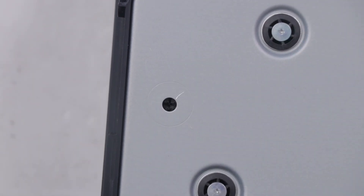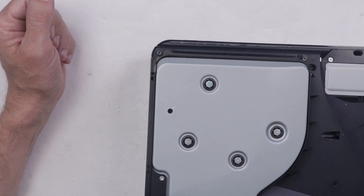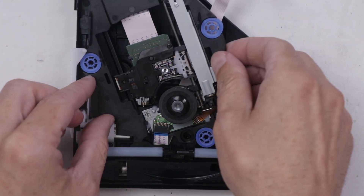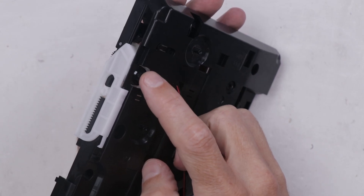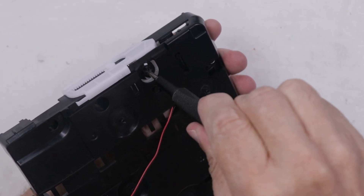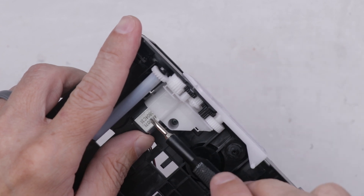Let's start it up and see how much noise is still there. I don't think that got rid of all of the noise, but let's check. Definitely a lot of noise there still. So since we still have a lot of noise, we've got to take the disk drive the rest of the way apart and have a look at those little gears. Right over here is the gear train of this disk drive, so let's remove the laser assembly. Now we can see just the motor and the gear train. On the top side is the manual eject screw, and that should operate this whole gear train when we turn it. But if I put my screwdriver in here, it does not turn either way — it's just totally bound up in there. But at the same time, I don't see any problems with any of these gears.